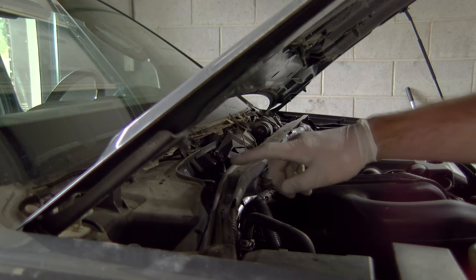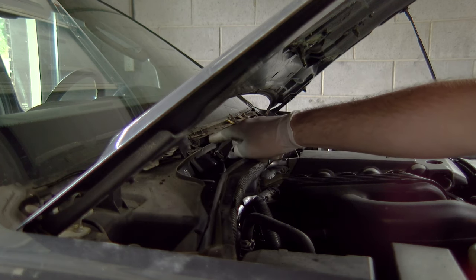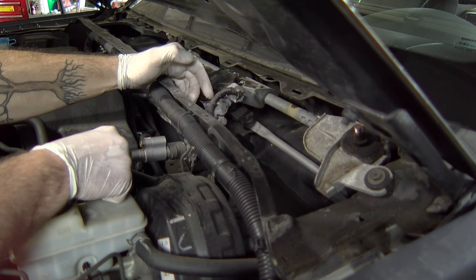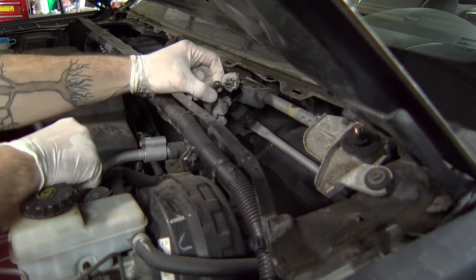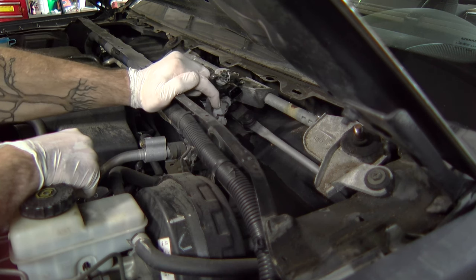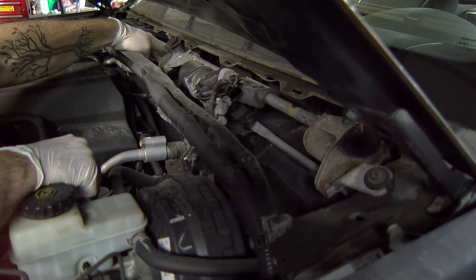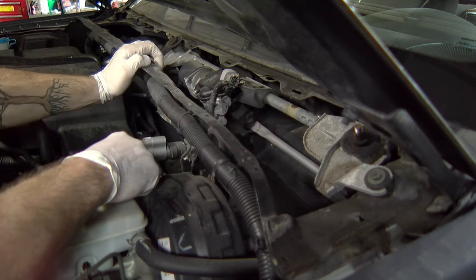This is another really good opportunity to go down in here and clean everything off. Right where your windshield meets the cowl a lot of stuff gets in there, and anything that's fallen in there you can go retrieve now. Since we're here, I might as well show you how to remove the windshield wiper motor — it's actually very simple. You have this electrical connector here, you just pull that off with your fingers. This clip just pushes into the aluminum frame — pull it out with a body clip remover. Then you have three bolts that look just like this: one, two, and then there's one right behind it. Remove those three, make sure your electrical is clear, and that entire assembly will just come right out.